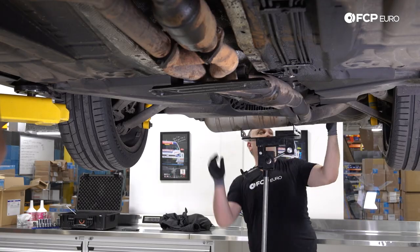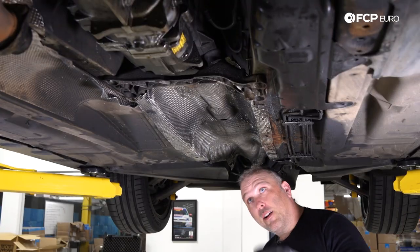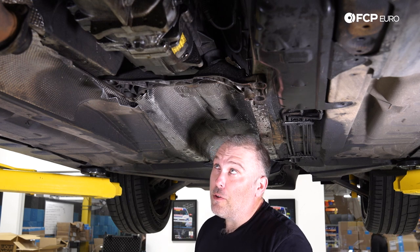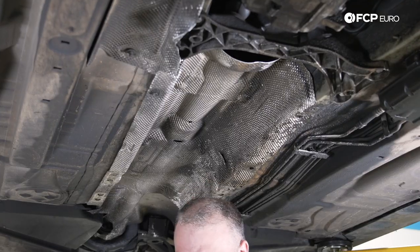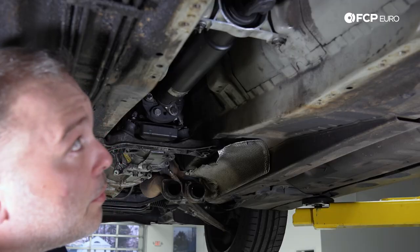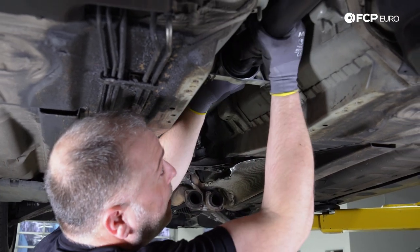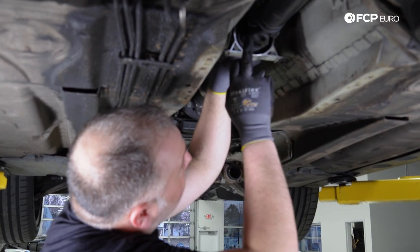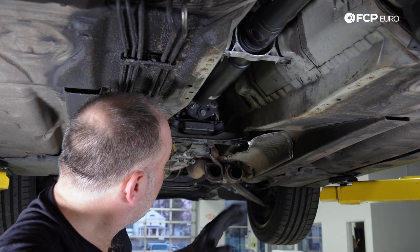I've got Ben supporting the exhaust from the front. I'm going to lower it down from the rear using this transmission jack. Next up, we're going to remove our heat shield to get to the drive shaft. It's held with a bunch of 8 and 10 millimeter nuts and screws — you'll want a deep socket for those just because a standard socket won't have the clearance you need. We're going to be replacing this drive shaft. It looks like a center support has been replaced at some point, but there is a little bit of play in the U-joint. I can move both halves of the drive shaft independently quite a bit, and there's quite a bit of grease and some brownish reddish dust in there, which is a pretty good indicator of a U-joint on its way out.